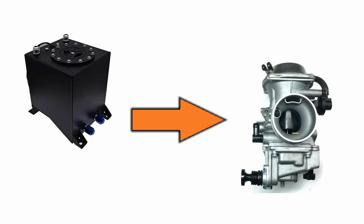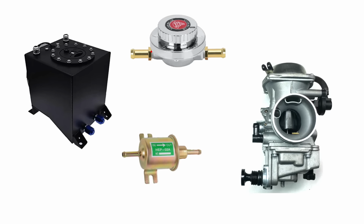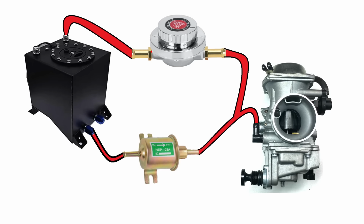So in order to supply fuel to the new carburetor, we're going to use a $10 electric fuel pump that's available on the Jungle site. This pump actually puts out too much fuel pressure for the simple carburetor, so we went ahead and got a deadhead type fuel pressure regulator. Now I've heard a lot of folks had problems with these regulators in the deadhead configuration, so we went ahead and added a return line, and long story short, here's a cartoon of what we built. Now I'm sure it may defy logic, but future Jimbo says it works fine. Yeah, it works fine, no worries. Anyway, that's what we did to solve the fuel pump and fuel pressure issue.